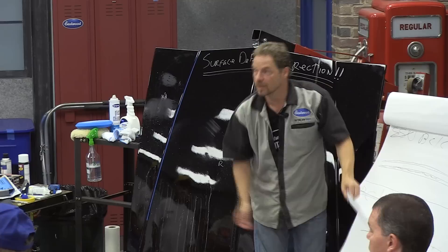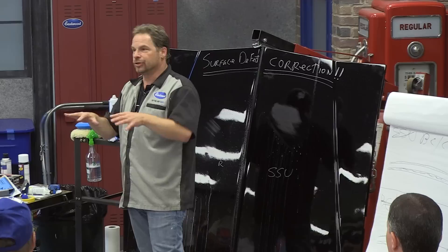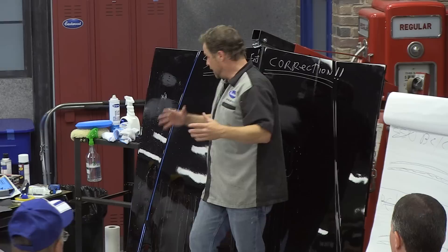After scraping the runs, can you just go right at it with compound, or do you have to sand it? You have to sand it. Even though you've got a finely tuned edge on your razor blade, it's still not perfect — it's not 2000 grit. And that's where I land: 2000 grit and above for gloss. You've got to follow through with your steps — correcting the surface to where you've got an even playing field for gloss, then bring it back up to full gloss.